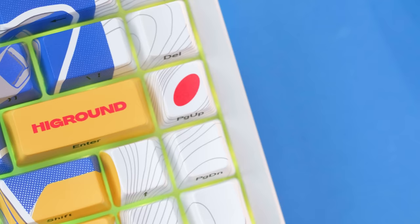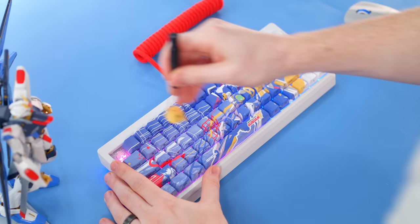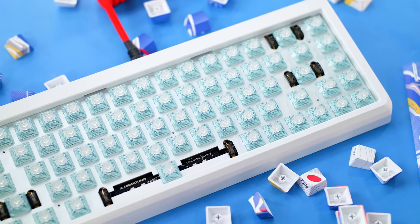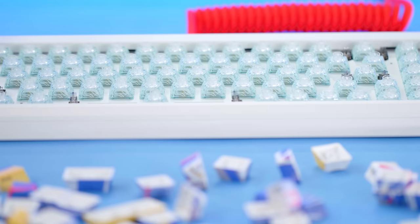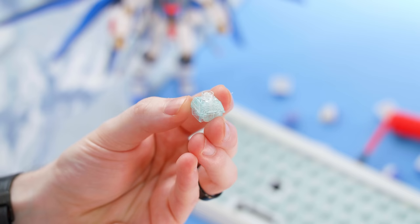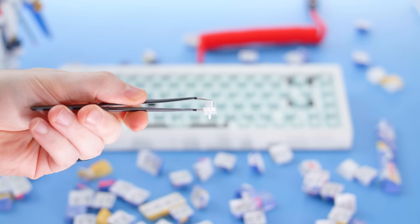Now this is where it starts to get interesting. Popping off the keycaps, inside the 01W they're using their very own unique graphics switch — they claim these are the world's first. Each switch has a topographic pattern printed onto the top shell, which looks incredible. This is their Thin Ice Geo switch: it's a pre-lubed linear switch with four millimeter travel distance, actuates at two millimeters under 33 grams, and it has a rounded stem versus the squared stem you're probably familiar with. Taking these apart, the construction is very interesting — the stem is made up of two separate pieces with a clear plastic top for the keycap mounts, and the bottom section of the stem appears to be a self-lubricating POM material.